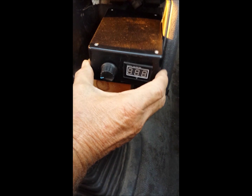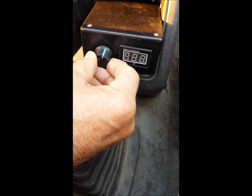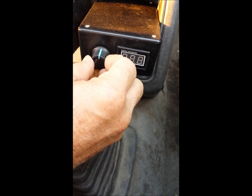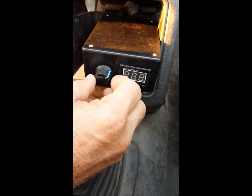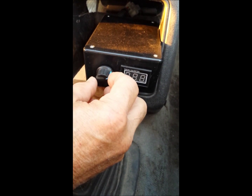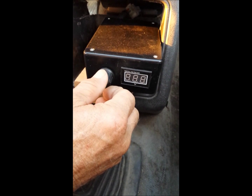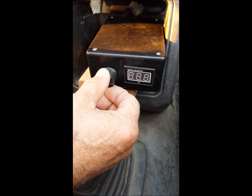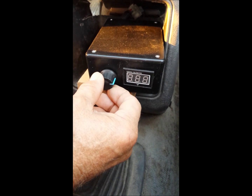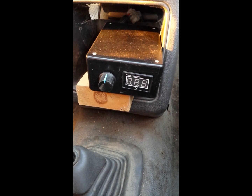Now what we have here inside the dash is the control box — the PWM. All the way off you can feel the click; it's off. When you turn it on it has the least resistance, so the PWM runs the fastest. As you increase the dial clockwise it will slow the injector down. We want to see how much miles per gallon it gains at whatever position.